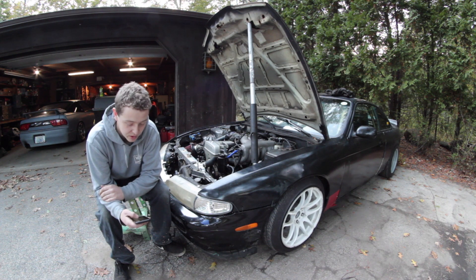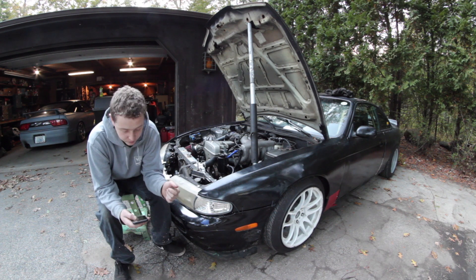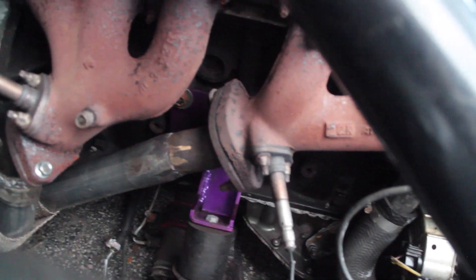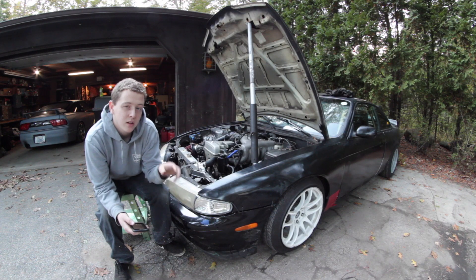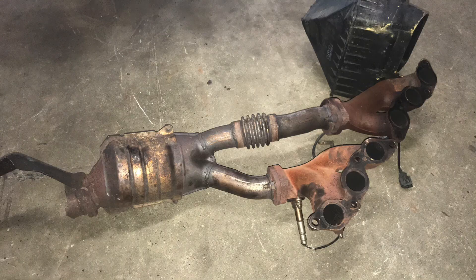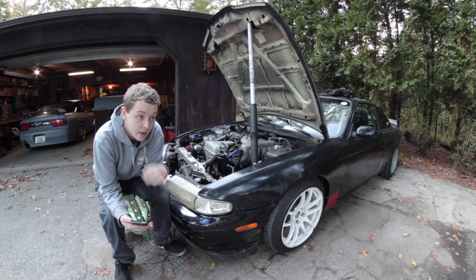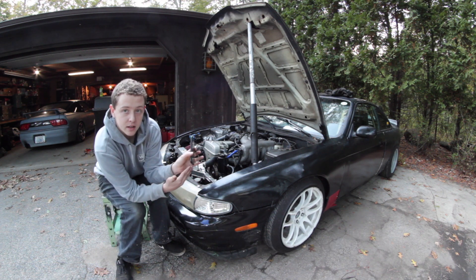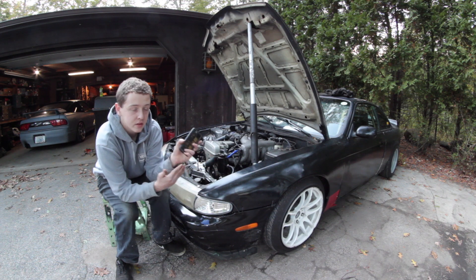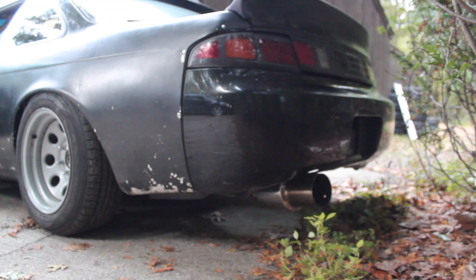RTV for the oil pan and shifter was $11 — I got two cans of it. Spark plugs checked out good. For headers, I made custom ones which saved money — about $15 to make. You need two pipes to delete the cat that go down and connect to each other, then connect those into a 3-inch pipe that ties into the ISR catback. I cut and rewelded that to get the full exhaust sorted.